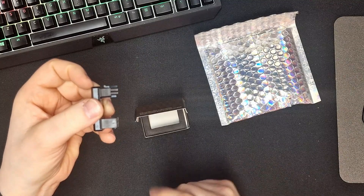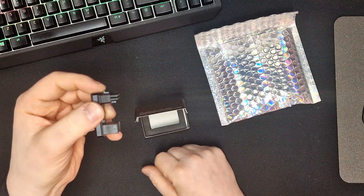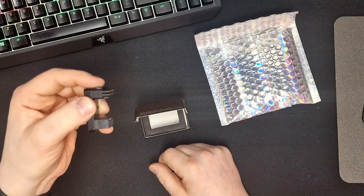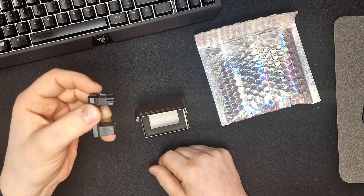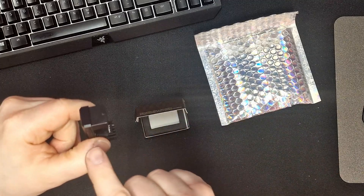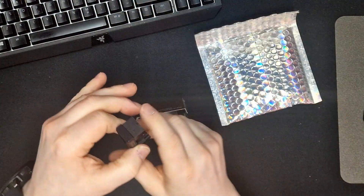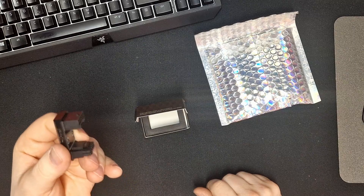The card I'm getting won't fit with the shroud and fans, but I'm going full water cooling because I already have a custom loop running — I just need to rip out the 3090 and put the 4090 in. The A version is the other way around, so the cable goes above the card toward the motherboard side in standard positioning.